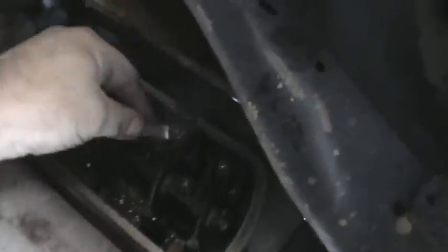Now you can check the intake valve and get a reference on the next one. You saw me just go from here to there. But the exhaust is gonna be open, so don't get in the habit of doing that. We're gonna tighten this one up a little bit. This side's actually a little bit loose. So let's make an adjustment here. I don't know if I can get the camera on this or not. I'll try to.